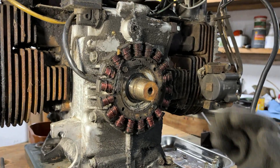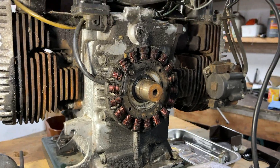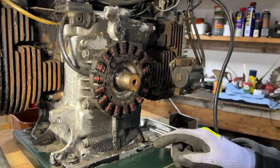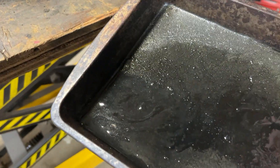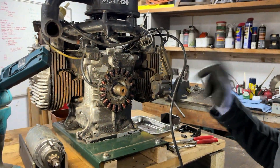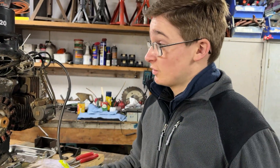That might just need some new bolts or possibly some spring washers to make sure that doesn't come undone again so it can stay rigid as it should be. Obviously the oil leaking out of this oil seal wouldn't have helped for keeping these bolts tight. Speaking of that, this whole front of the engine is completely covered in oil, and that'll obviously need quite a big cleanup at some point. But before we go spending money on parts like the oil seal or spending tons more time cleaning it up, we want to make sure this engine is actually viable first. One thing we have done off camera is drop a bit of oil out of it — you can see in this corner of the tray it is a bit cloudy, which shows it might have a bit of water in it. Also it smells like it's got petrol in it, which really isn't very good and says multiple things about the fuel system on this tractor. So it'll need an oil and oil filter change before we attempt to start this up.